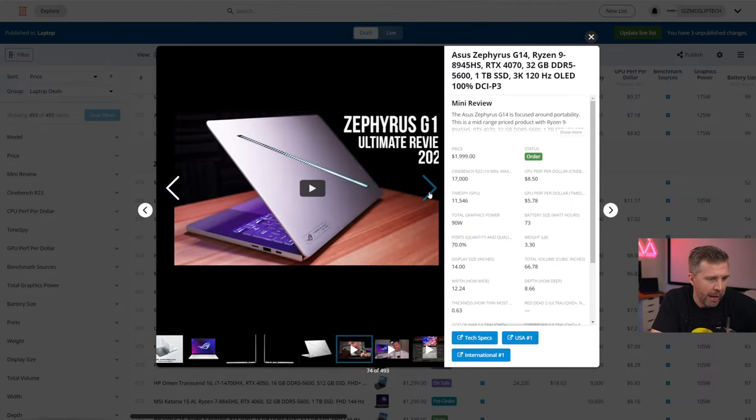So keep in mind, Spyder 5 Elite underestimates color gamut by about 7%, we'll say. And right here, we've got 94% of sRGB, only 72% Adobe, and 73% of the P3 color gamut, which I'm pretty sure is supposed to be a 100% P3 color gamut display, which makes me think that we have the display in the wrong mode for displaying color or something, because I thought this OLED display could go to 100% of the P3 color gamut, but it seems like it's set on sRGB mode or something.